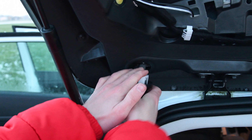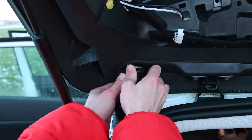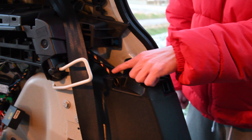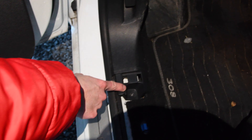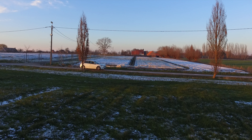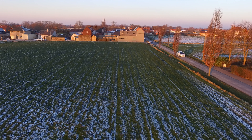To put this back in place, firstly pull out the white part and put it back into the black rubber part, then put them both back into your trunk. The last thing you'll have to do is pull the black cable of the camera all the way to the front to the CarPlay unit. To put the black cable behind the plastic, just pull the plastic part and then pull it all the way down to the bottom of the car. Because this part can't come loose, you'll just have to push the black cable between the soft tissue and the plastic. Next to the driver's seat, you can remove the plastic and put the black cable under it. Unscrew the screw and then pull the cable under the steering wheel to the CarPlay unit. To know how to remove the parts under the steering wheel and the middle part of the radio, watch our previous video on how to install a CarPlay unit. If you don't have a CarPlay unit but you want to install the backup camera, we have put a link to a special unit for this in our description, because it is not possible to connect the camera to our original Peugeot radio.